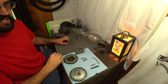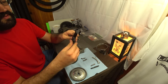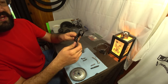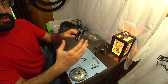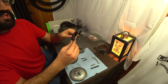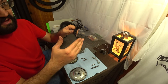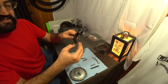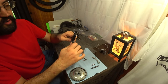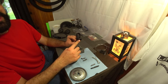Let's go over the parts and talk about some basic information, starting with the clutch lever. There's a barrel nut on the end of each clutch lever in these kits. This is not designed for long-term adjustments. The only time you ever need to be unscrewing this barrel nut is if you had an issue pop up while you're riding and you need that adjustment to take up the play. If you're using this to permanently adjust your clutch cable tension, you're damaging parts. This is not the proper way to adjust a clutch cable.